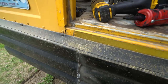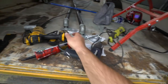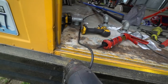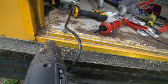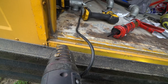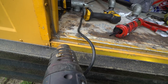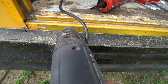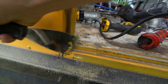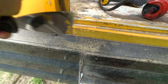You see this nasty reflective stuff? We have this eraser wheel here and it can work but it's a lot of work. What I've been using is this heat gun. For demonstration: you just heat up the spot — I do it with two hands, left hand in front of my right hand — move both hands at the same time, scrape and heat. For the purposes of this demonstration it's not so easy, but take my word for it.